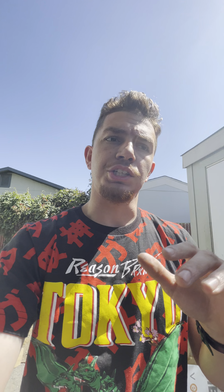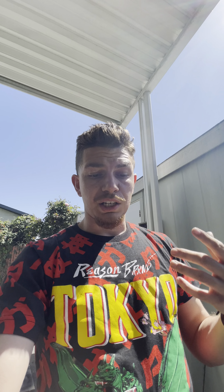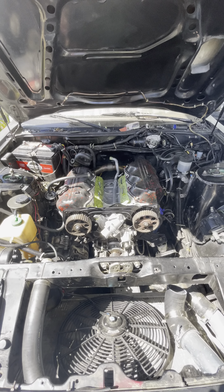That's one of the main things you have to know about the VG33 manifolds, and that's basically what's holding me up — getting that thing totally resealed. I got the crossover pipe in already and have it locked down, so all I have to do is put these last two bolts in, get this coolant line back — I gotta go buy one of those — and then redo my timing, coolant, and all my wiring.